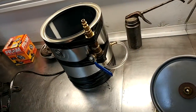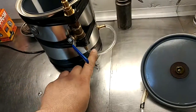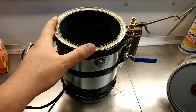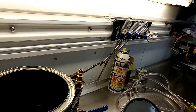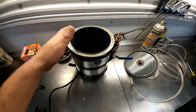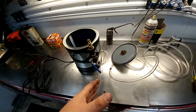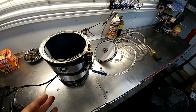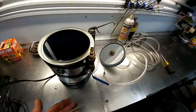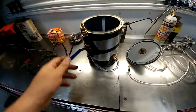We have our air supply — hook this up to shop air. These cans are cheap, but they expand, and once they start expanding the cap doesn't make a good seal and it starts blowing smoke out everywhere. For testing EVAP you don't want to go more than two pounds. I test my air intake with this and went about five pounds — it works very well.